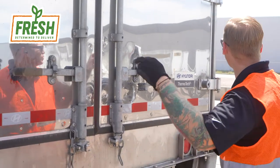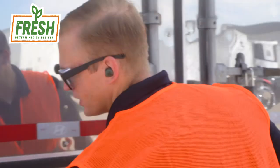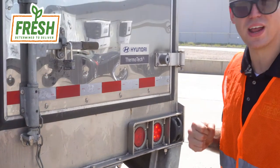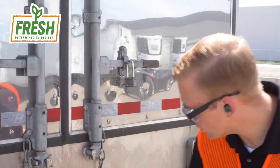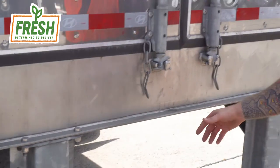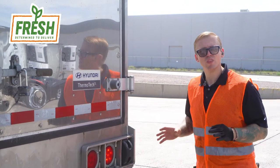Check your weather stripping around the door — make sure nothing's torn or missing, and that the inside of your trailer is sealed. Check your bump stops, make sure they're in place and not damaged. Check your DOT bumper — make sure your DOT reflection tape is in place and the bumper isn't bent anywhere. Make sure your door also has door chain latches, so when you open your door to load or unload, you can swing the door around and latch it safely while moving the vehicle.